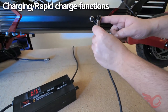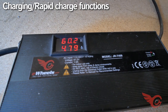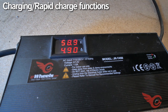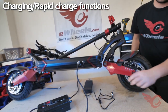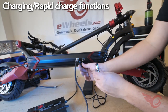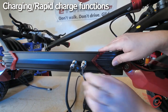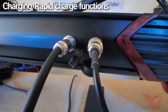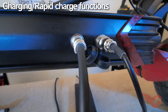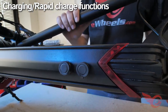More amps will charge the battery faster. As the battery approaches full, the amp readout will decrease. Lithium battery packs have reduced degradation if they are kept partially charged. The max charge toggle setting sets the rapid charger at the specified 80, 90, or 100%. To get the most battery lifespan from your scooter, it's recommended to use the 80 to 90% settings for shorter trips and the 100% option if you're planning an extended excursion.